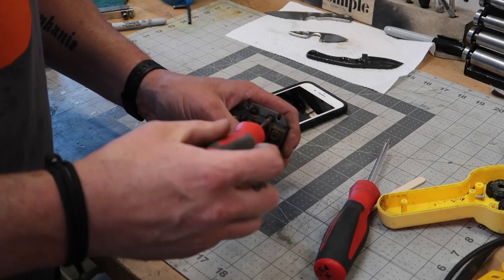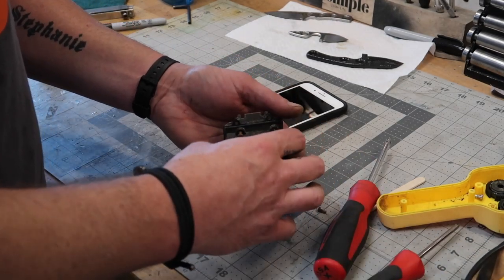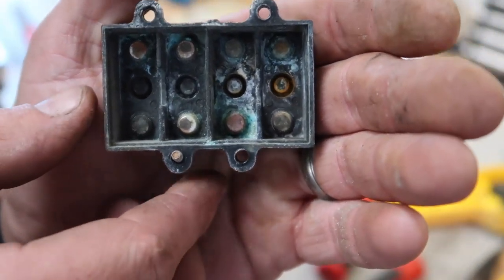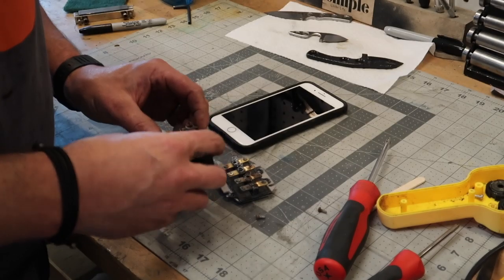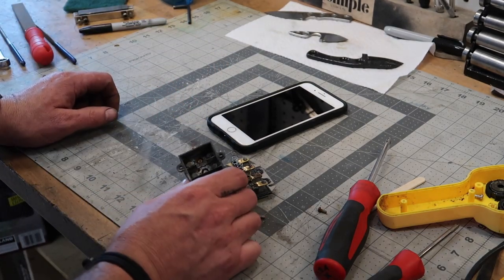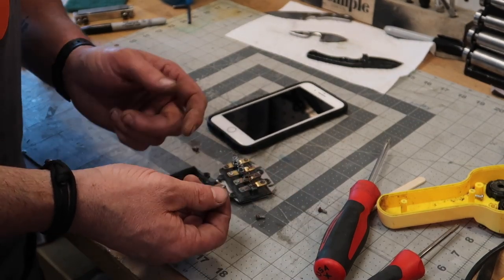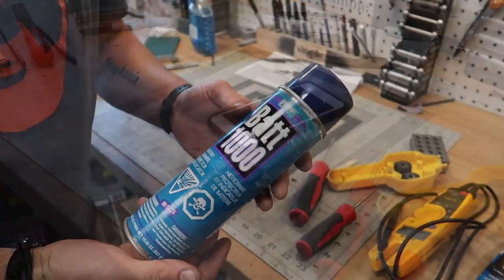This should open this thing right up. Let's see what's happening. Oh yeah, look at that — no wonder this thing is not working. There's no way you're going to get contact there at all. So what I need to do is clean this up. I think I have some electrical contact cleaner out in the sea can. I need to clean all this up in here and I think we should be able to put it back together. I'm also going to need to find some other screws — I'm not going to put that stripped one back in. I think we found the problem.